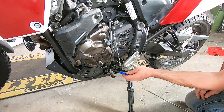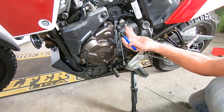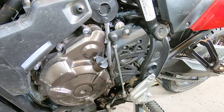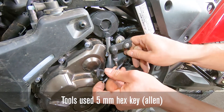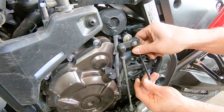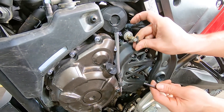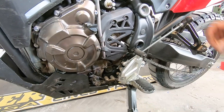A great tool tip: let's get the shifter out of the way. The easiest way is to come up here and pull the linkage. Before pulling it, there's a hash mark that's aligned with the OEM position — I'm going to put a little dot there to ensure I get it back in the correct location. This is an M5 or number-5 Allen key. The bolt has to come all the way off because the spline gets locked by the bolt — just loosening isn't enough. With the linkage out of the way, you can rotate the shifter all the way up and out of the way.